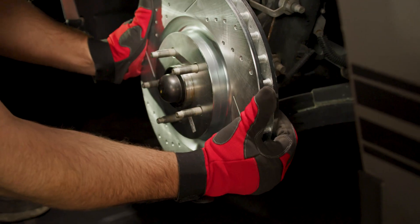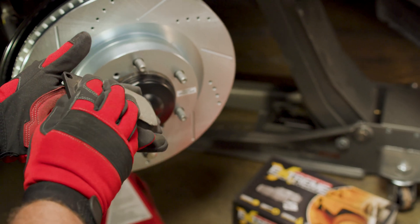When installing both new pads and new rotors, there is a fresh surface to make the initial layer of friction. When doing a pad slap, where new pads are installed on old rotors, the surface is worn out and a strong transfer layer cannot be created.